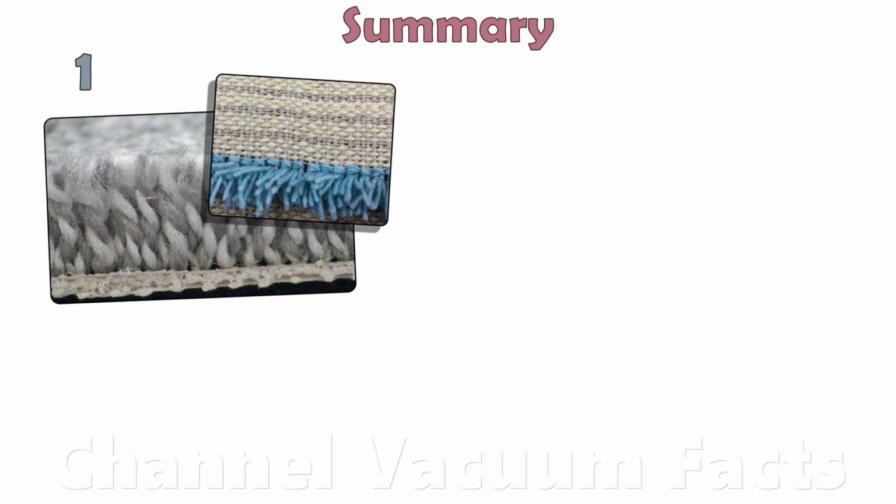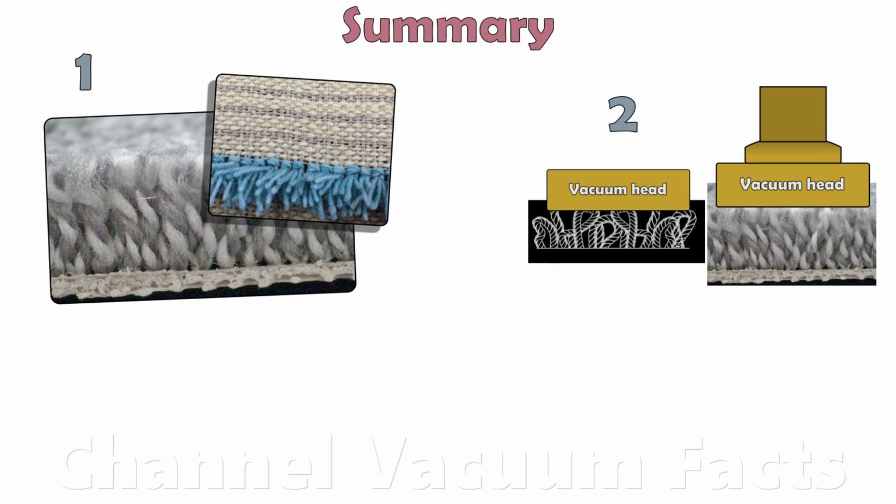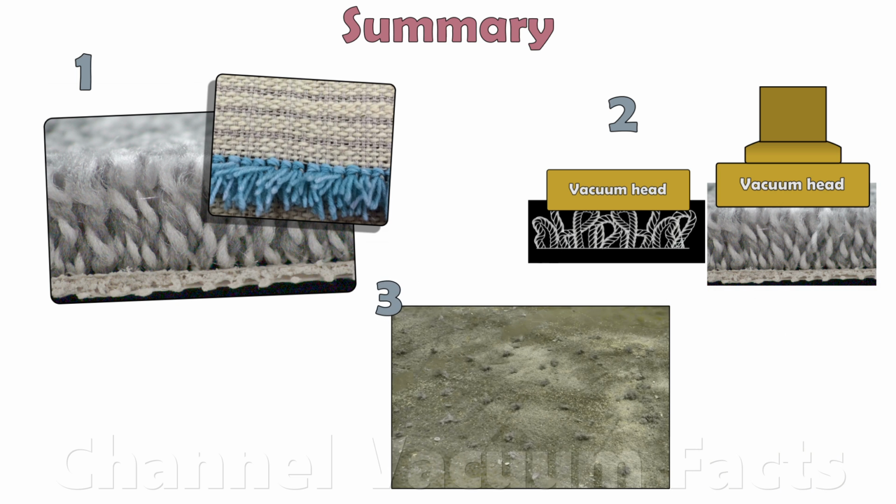It's important to learn to spot the three main sources of deception when low suction, high airflow machines such as a Kirby appear in amateur testing so you're not fooled. Firstly, make sure you spot the type of flooring they're vacuuming. A shaggy rug is not the same as a fitted carpet with waterproof, non-porous backing that restricts airflow. Secondly, long floppy tassels make for bad suction seals, which artificially inflates the performance of high airflow, low suction machines, unlike flat piles of a fitted carpet. And finally, the use of exaggerated messes also artificially inflates those two deceptions.